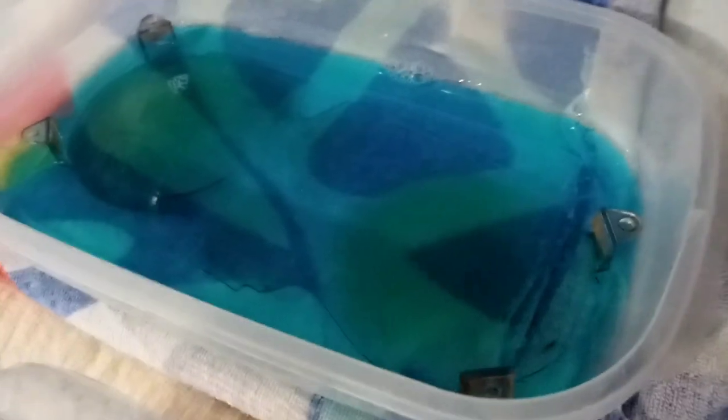You can see the yellow tinting around the lens — that's from UV sun exposure, probably shining on your dashboard for 30 or 40 years. Just let that sit for a few hours, then come back and wipe it a little bit, put it back in the container, and wipe a little bit more. Some people use sandpaper techniques — use a rough sandpaper, something like 1000 grit, then work your way up to 1500 grit and buff it out. You can also put a top over the container and let it cure a little more.